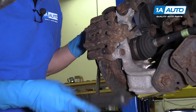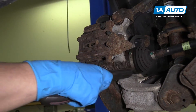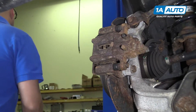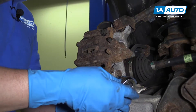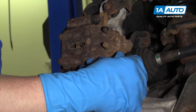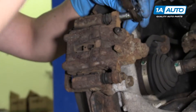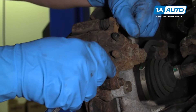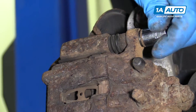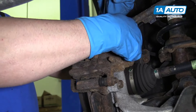This caliper is kind of rusty and the bolts are kind of rusty. I'm just going to take a wire brush before I take these bolts out so that my socket fits a little bit better. I'll wire brush the bolts for a second. Now I'll take a 12-millimeter socket and a ratchet and loosen these bolts up. If the caliper pin starts spinning, you can put a wrench on that — use a 17-millimeter wrench to hold it from spinning.